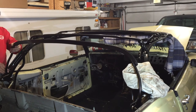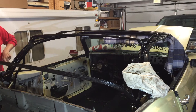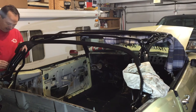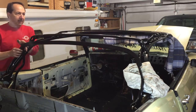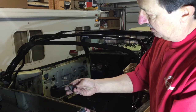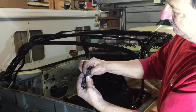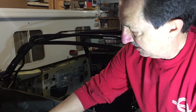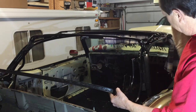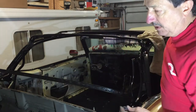This curve orientation is correct — if you had it the other way around, it wouldn't be able to go all the way down. There are two rubber stoppers that stop this piece, and both of those were destroyed — they just completely fell apart. So I did buy new ones. These are the old petrified, broken pieces versus the new soft rubber ones. It definitely pays to check all these little areas and pinch points to make sure they are working properly and have good stops the way they're intended to be.